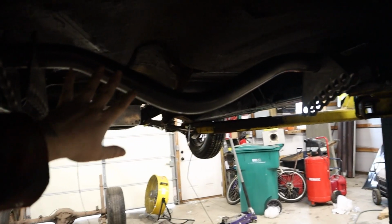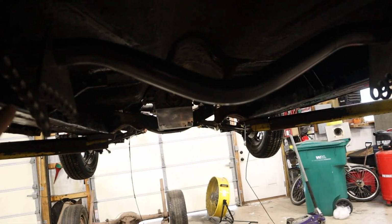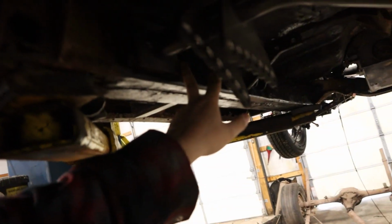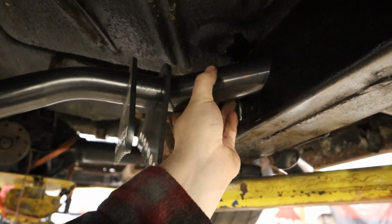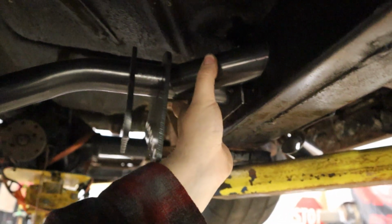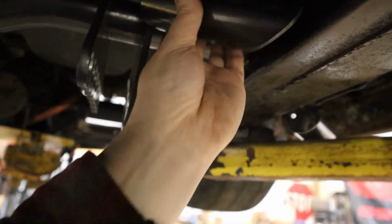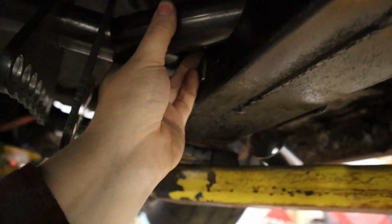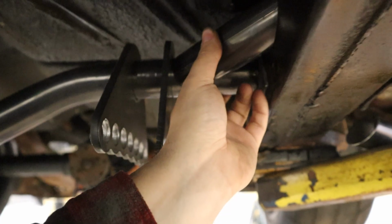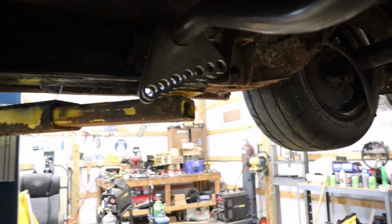All right, cross members back in, got the new ladder bar brackets on, got the end plates to weld to the frame. I'm about to probably just get the sides welded on this and get these gussets at least tacked in place. That way all this is secured. I obviously need to weld through here first before putting the gusset on. And then, like I said, I'll get that tacked on. And that'll also help brace the ladder bar plates or brackets.